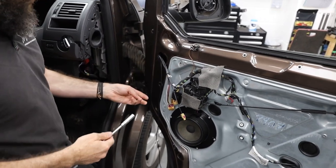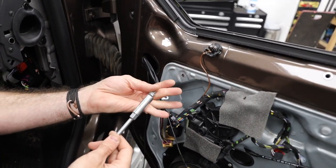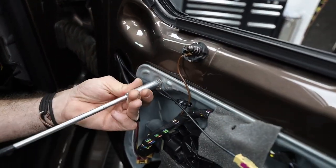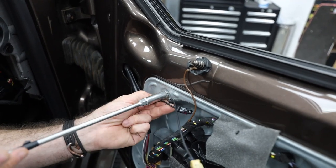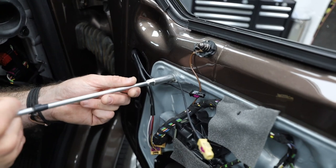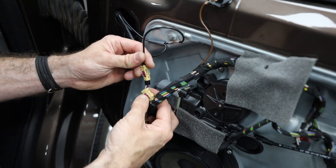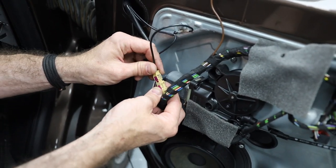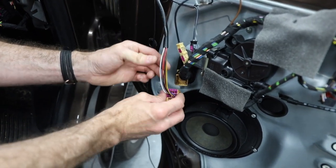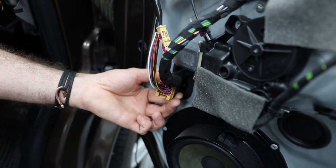Step 23: put the 10mm bolt back onto the door — that is the ground for the antennas. If you don't fix this, the antenna will not work properly. Then the FM plug goes back into the existing one you unplugged, leaving you with the DAB. Reconnect the wing mirror electrics too, otherwise it won't heat and won't electrically adjust or fold if you've got folding mirrors.